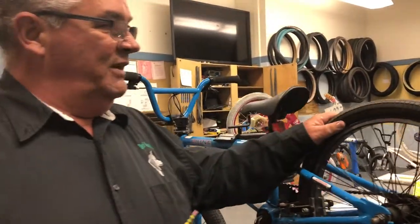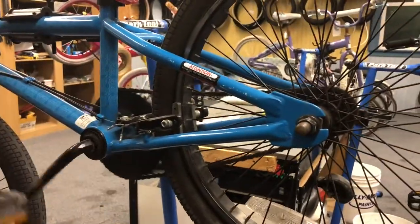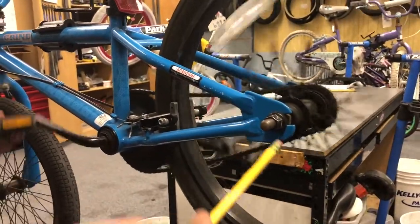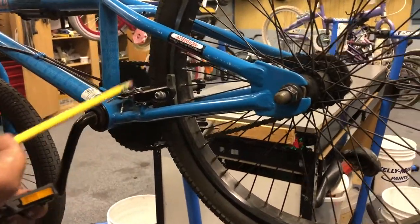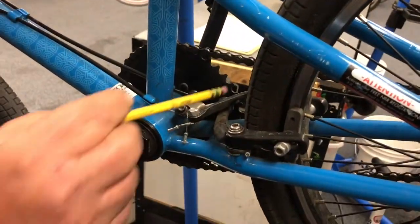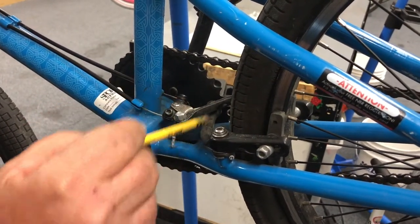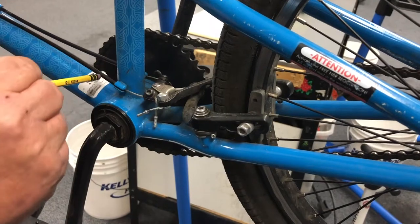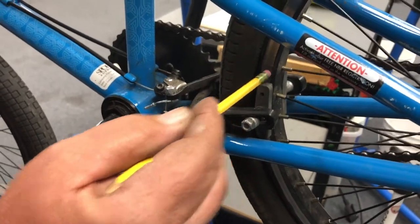With the advancement in bicycles and the BMX movement, pedaling backwards was not an option because they needed to be able to pedal backwards to do tricks. So they went with a freewheeling hub. What the designers did is mount two points on the frame, and the brake arms are longer and bent at an angle so that when you pull on the brake, there are dual cables that pull at two different points, putting more pressure and better stopping power on the rear wheel.